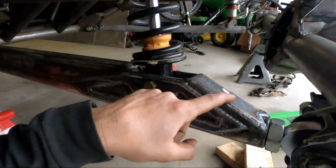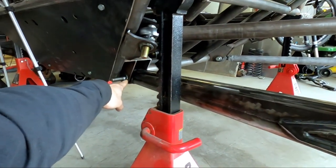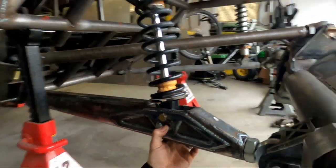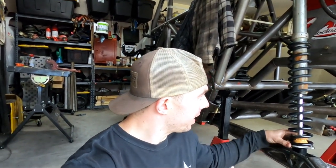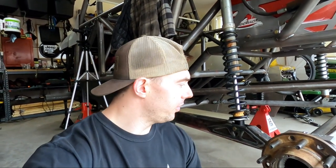Got everything welded up. Internally we have our external gusset, the anti-wobble piece with a cover plate on top, and drain plugs on both sides. This is our trailing arm system — we'll have some adjustability in the rear, and the coilover is attached and ready to go. I just have to duplicate this process on the other side. I'll work on the front axle next after I finish the other trailing arm, so stay tuned. Hope you guys liked what you saw — hit the like button, comment below what you'd have done differently, and subscribe if you haven't yet.